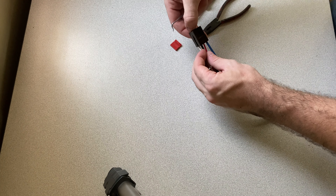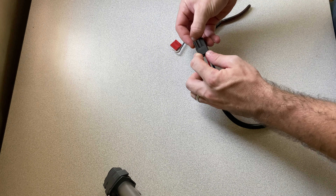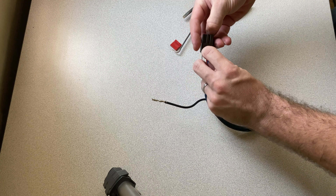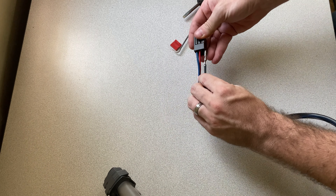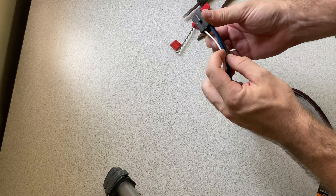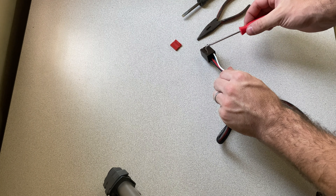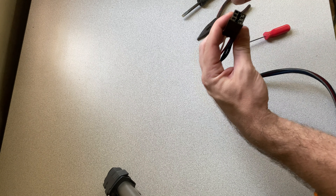So here we go. If your truck requires a rewire, that's all you need to do. You swap the blue and the black ones, and move the white pin from this slot up into the top one, and then go ahead and replace the connector piece.